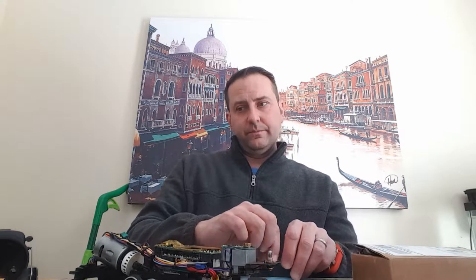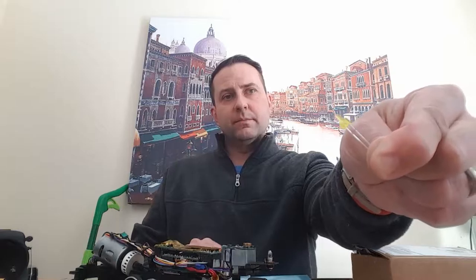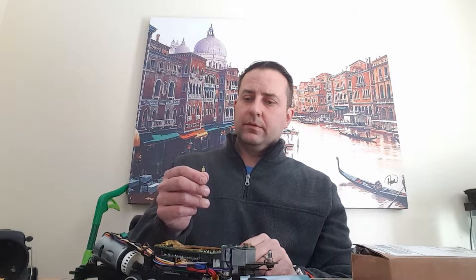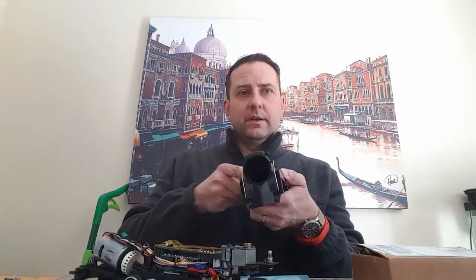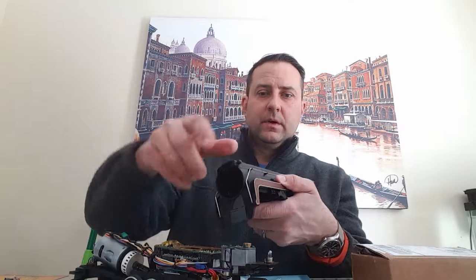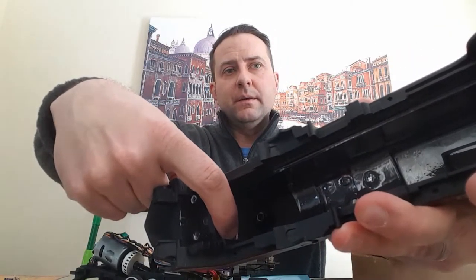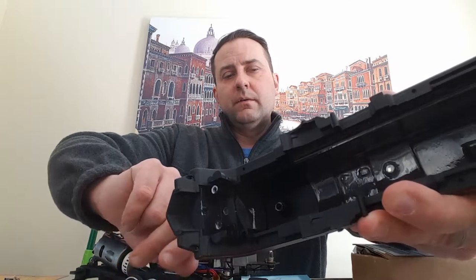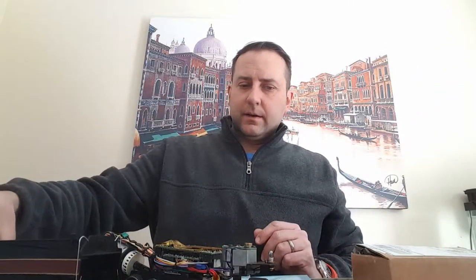I'm going to install these LEDs here that are like an amber yellow. These are the long stem types that will slip right into the marker spot pretty simply. You might have to over-drill a little bit, but it's not too bad. What I've done with the shell is I've drilled the side out through the shell itself. I drilled this out down deep so it comes out clearly on both sides inside the shell. I'll bore it out a little bit, then insert the LED in there so it lights up the entire marker itself.